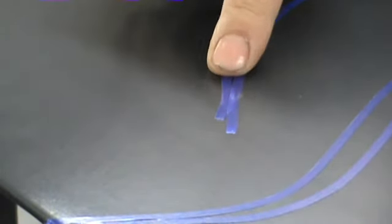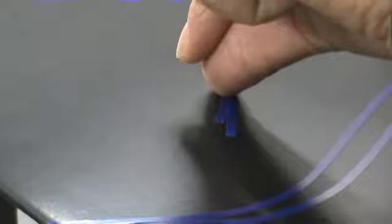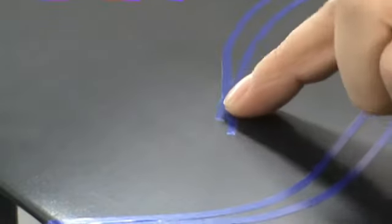Okay, the first thing you're going to want to do is, on each corner, each tip, make sure the tape is pressed down where that comes up. What I like to do is, there's several different ways. Sometimes I just run my fingertip across it. Or I could run that across it. But you want to make sure you got all those down in every tip and everywhere on your flame job. If you don't, what that's going to do is bleed through. You don't want to bleed through, not at this point.